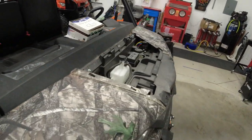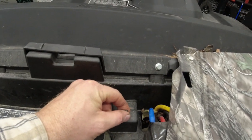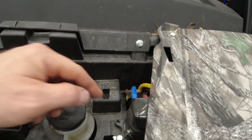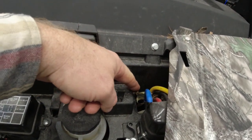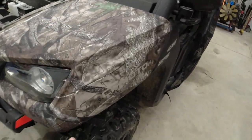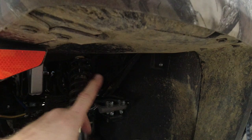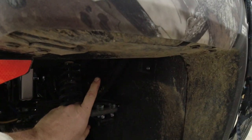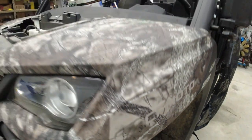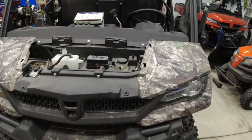The turn signal relay, it's got a little rubber thing on it and it sits right on this. The wiring for it is probably tucked down inside the hole here. I don't think we have to pop this off. It's probably just going to be this panel underneath here, but that's all right because we'll have to pull all that off anyway to get at wiring later. But I'll get this stuff taken apart, show you what the harness looks like that the flasher plugs into. We'll get that part of it done because that's the easy stuff, and then we'll move on to the next.